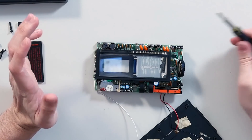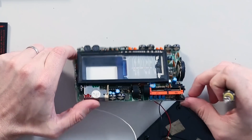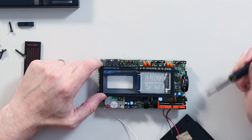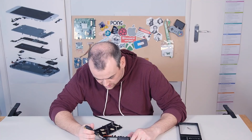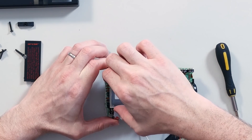That produces what looks like a widescreen rectangle — that's the screen. You don't get a nice uniform pixel size, but it's stretched by the Fresnel lens to appear 4:3, the old aspect ratio for TV. There are lots of pots around here for calibration and configuration. You can see the CRT is sealed and under vacuum — at the glass end it was vacuumed out, heated, and sealed. The connections to the CRT are visible here, and the front plate is just fixed on, glued and sealed to maintain the vacuum.